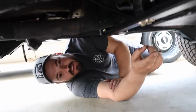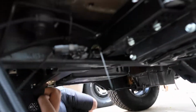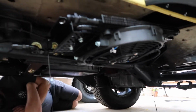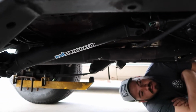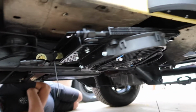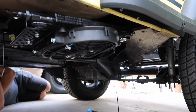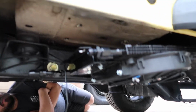Oh, yeah. Let's see. This little Jegs trans cooler. It's like $120. We're in the process of getting those dialed in right now. We had to get some new fittings for it. We had to put it out here because there's not much room under this small frame and your exhaust. This way, if something lets go, like a drive shaft or a rock bounces up, I hope it'll keep that in the clear. It's not bad. And if it doesn't, then we'll figure out a new spot.